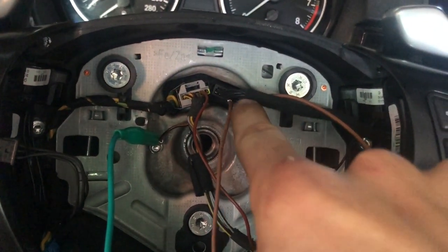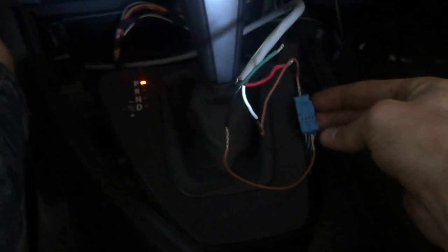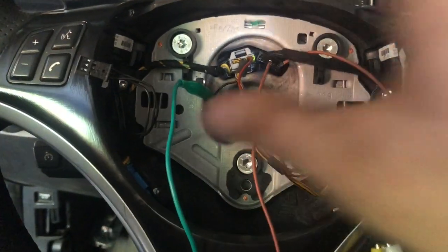It's pin four and pin six, and then it goes to one and three on the actual paddle shifter, and the middle one goes to ground. So on the connector here, pin four and six go to one and three on the paddle shifters, and then two goes to ground. On the back of here, down to the connector, it's pin two and four, and then to the middle two pins — two and three. I've got it all connected now, the shifter's working. I'm going to build another wiring harness to bypass the multifunction controls and make it all work.